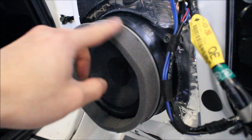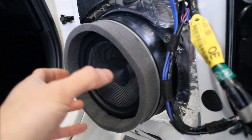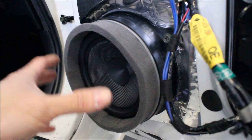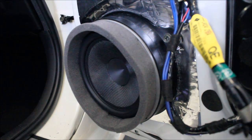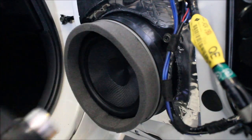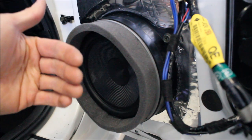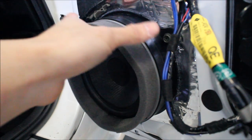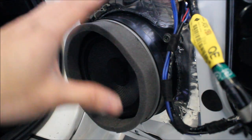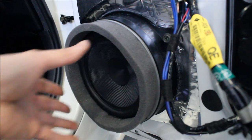Why did I put foam on the outside of the speaker around the surround? These mid-range sound waves aren't as directional as higher frequencies. The reason why people sometimes say they lost bass when swapping factory speakers is that factory speakers are thick — they're engineered so they're closer to the door skin and the bass can travel immediately into the cab. If you just drop aftermarket speakers straight onto the door with a huge gap between the door skin and the panel, a lot of that music and energy gets trapped inside. That's why we space the speakers out and add this foam ring as a gasket, to make sure all the sound waves enter the cabin and you get the most sound quality possible.